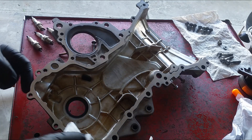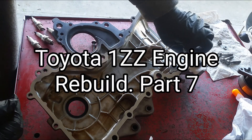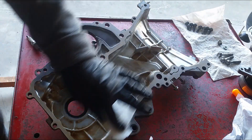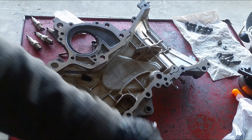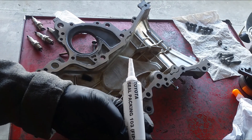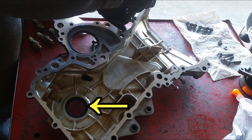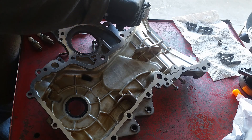What's up guys, welcome back to my channel. This is a continuation on my rebuild on my 2000 Toyota Celica 1ZZ motor. Here I have the timing chain cover getting the surface cleaned up so I can put the gasket sealant on the contact surface mating area. Also, while I got the timing cover off, I went ahead and replaced the front main seal right there — it's easy to access since everything is out.